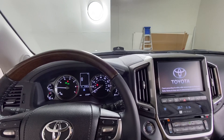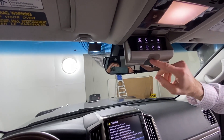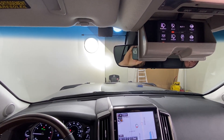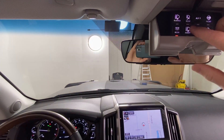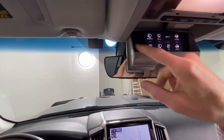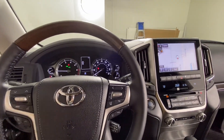This car's got 673 miles on it. We re-geared it with Nitro 4.30 gears. We also did ARB air lockers front and rear. Here you can see: front bumper lights, rock lights on, white lights on the roof light bar, ambers on the light bar, twin air compressor, aux battery, front and rear lockers — all connected through the Switch Pro.